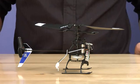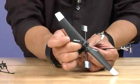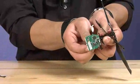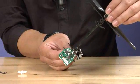To replace your main shaft, you begin by removing the main landing gear. Then you pop off the control links. Then, go ahead and hold on to your rotor head securely and pull off the main gear. Then the whole rotor head assembly will slide right off.